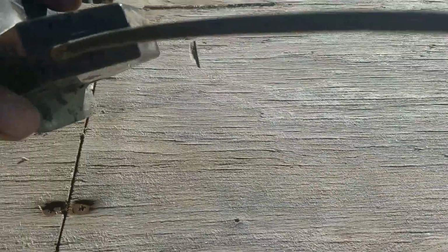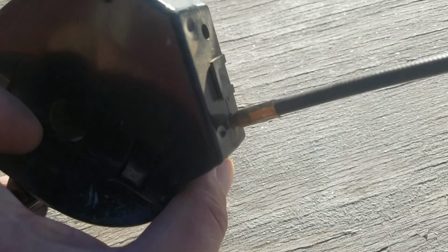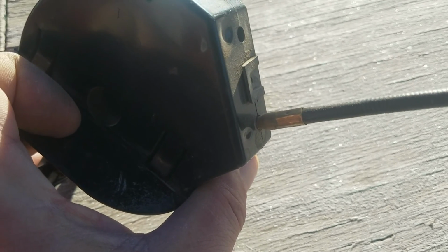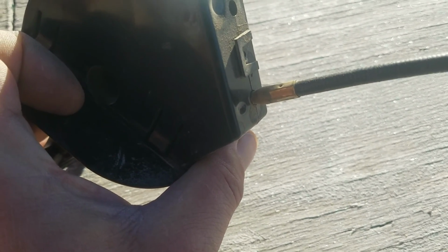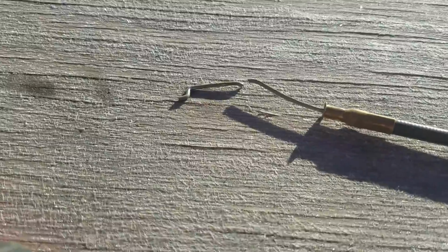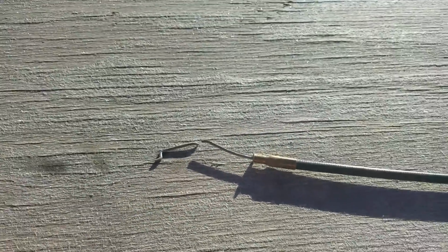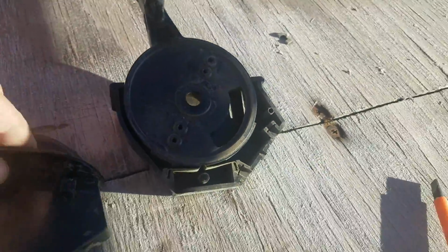To open up the housing, you see on the bottom part there's a snapper. Again, I'm gonna use two hands now for that, and we will see it soon, the inside of the throttle control. So in my case, I'm a little bit unlucky because the cable broke, and in this case you have to replace the entire unit. But that's how it looks like opened up.